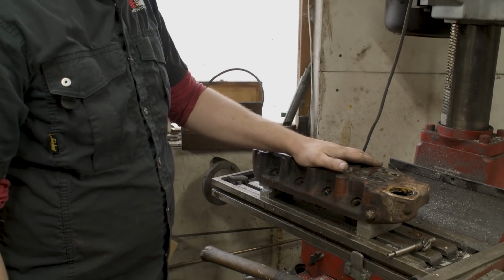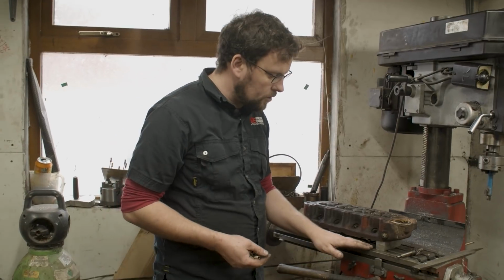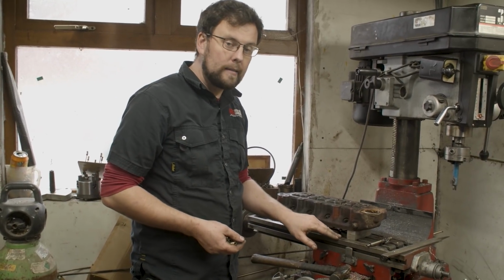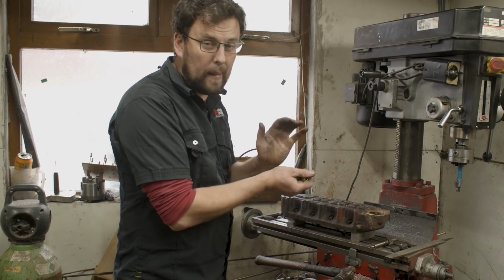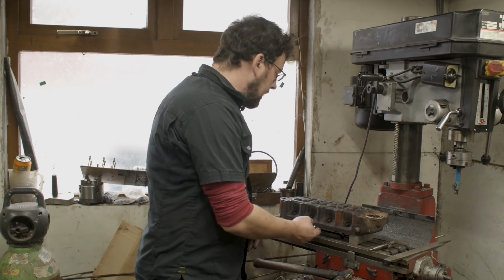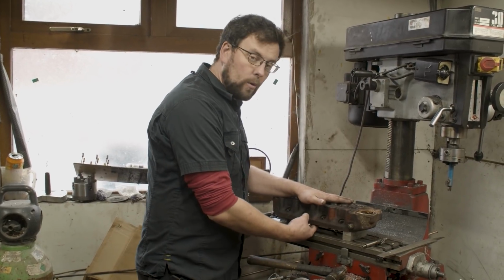So when I'm banging on the cylinder head to put these guides in, I'm not going to put dents into the table of my milling machine, or put dents into the cast iron of the cylinder head. So we're not banging 2 iron surfaces together. You can't actually see, but there is a third block in the middle. It's important to evenly support the cylinder head.